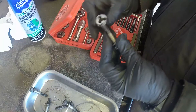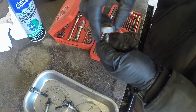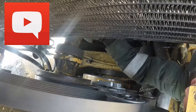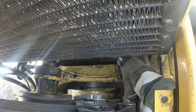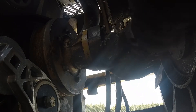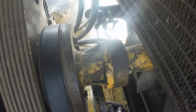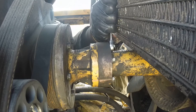We need to put the brackets back. Clean those fan hub bolts — we don't want any dirt on the threads. Use compressed air to clean those holes and threads. If you have any questions drop them in the comment section below. We have those alignment match marks on the fan hub and the pulley, making it easy to align and start the bolts by hand without chasing the holes. The radiator fan is pretty heavy and not very comfortable to maneuver. Tighten on a diagonal cross pattern.